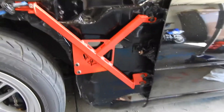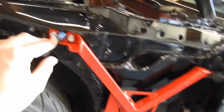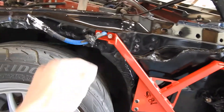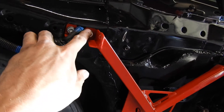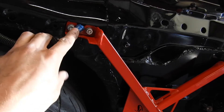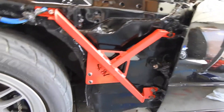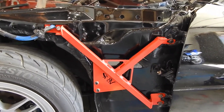Alright, so this side is completely done now. Like I said, it's very easy. All you're going to do is drill one hole for this back bolt - this one goes right through. After you drill those, you're going to make sure you get this wiring here for the airbag sensors. You want to let it sit right in that little divot on the bracket so it doesn't get pinched in between there. Just make sure everything is nice and tight and add all the washers and hardware.